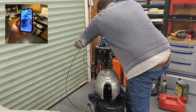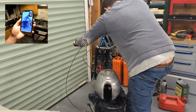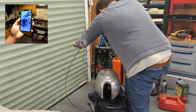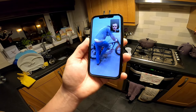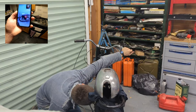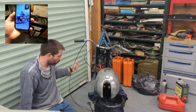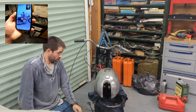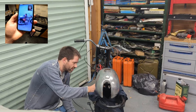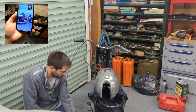Yeah, it might not start for weeks. Major Mike's drunk. Just not going. This is exactly how mine was though. You might have to mark the dizzy under the clamp and just turn it a fraction each way. Well, I got a bubble, didn't I, before we... Before you flooded it? Before we attached the fuel, yeah. I'll turn off the petrol a minute just in case it's flooding. Although, it's not dribbling out, so I don't think it's flooding.